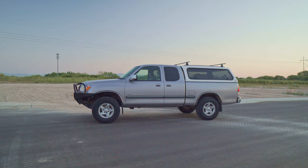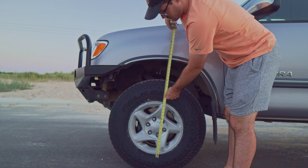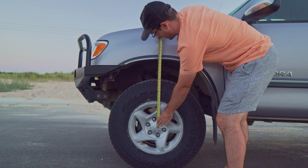These 32s are perfect. They'll do great in snow, be nice and quiet on the highway, give me a little bit of ride height, visually look good, and they'll last forever because these are light truck tires. We got the new tires on — these are 235-85 R16, supposed to be about 31.7 inches tall. We're now sitting at about 37 inches for that measurement, with about 22 and a quarter on the other side.